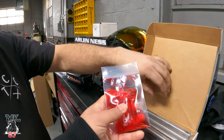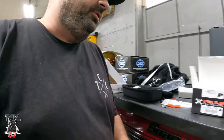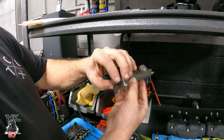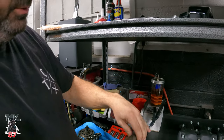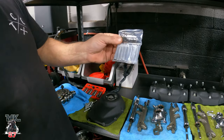What's this nice lubricant here for? That lubricant got smashed. So these things here, if you come around here, what generally happens, and this actually happened on your Lowrider, was these bolts start to back their way out, and then the rocker shafts start to lift. And then you can create some noise, so replacing with studs and lug nuts. Nice.